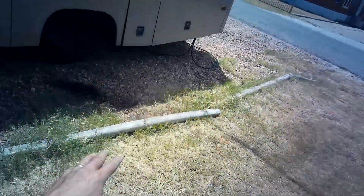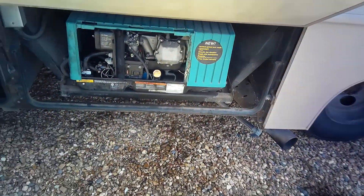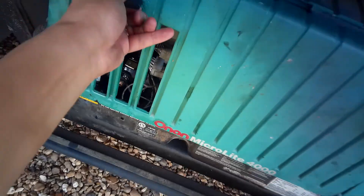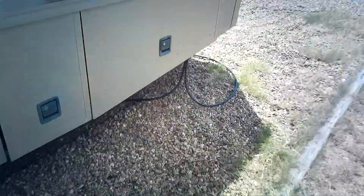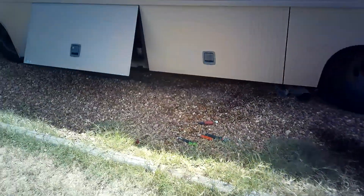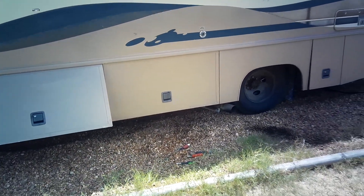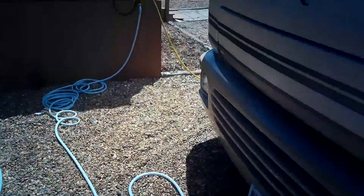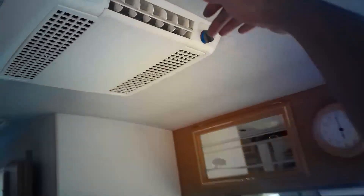The black smoke will happen when it starts up and when it cools down — it's just kind of normal as part of it. Running strong. We are plugged into the shoreline with the generator on, so it's running out of that, and it's definitely doing a lot better. Thank you so much for that feedback. I was reading some forums that the pulsating seems to be normal, but before it wasn't normal because it dropped a whole lot. It is normal for it to fluctuate 2 to 3 volts up and down as it's being used. The AC blows a lot stronger now, a lot colder. Definitely better than before — thank you and talk to you then.